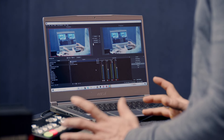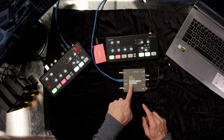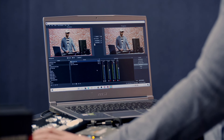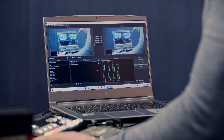That is how you do it. It's this little device that nobody talks about, but it changes everything. Here's the signal chain: you come out Ethernet, turn on your stream, plug Ethernet into your streaming bridge, come HDMI out of your streaming bridge, into the capture card, into your laptop computer via USB — and there it is, you have switcher capability. One thing you'll notice is that it's going to be on a little bit of a delay, but it's fine — it's a pretty quick delay.